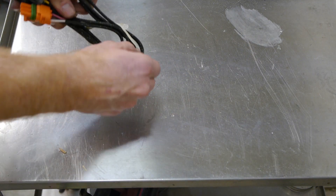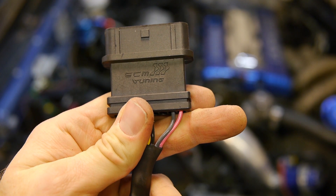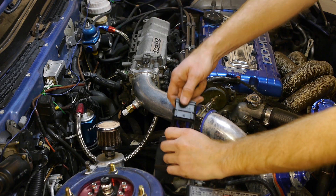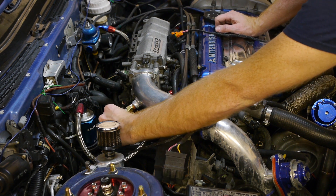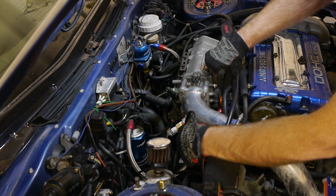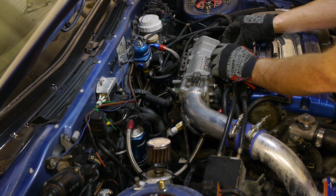I'm really impressed with the quality of this pre-wired piece, especially if you're as bad at wiring as I am — it looks just pristine. Definitely worth it. Then just plug in the connectors: the big one goes to the mass airflow sensor connector, one goes to the GM MAP sensor, and the last one goes into the GM IAT sensor. Easy as pie. Let's also reroute the MAP sensor one — there, that's better.